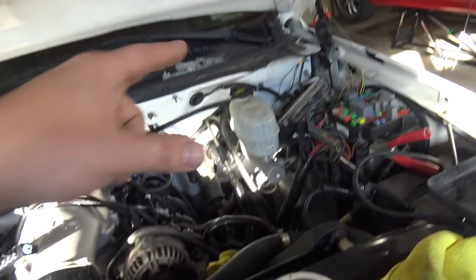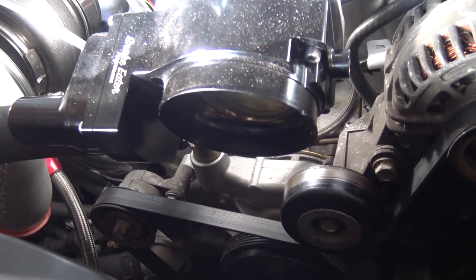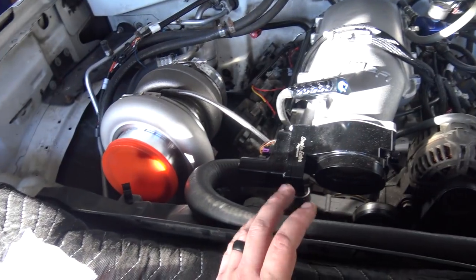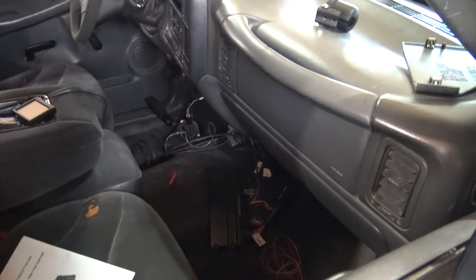I'm going to close it up and try to put the ECU back there — I cut the mount out of the body, gave myself a little more room. The fans came out farther than I thought — they're not exact fits because this is like a Duramax thing. I had to do this adjustment, and I may see if he has Duramax electric fans. I just had to nip these up, so there are little air gaps I was going to put HVAC tape on, but these fans are so powerful that probably doesn't matter.